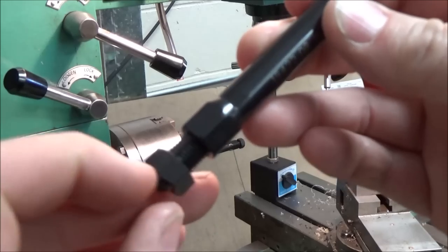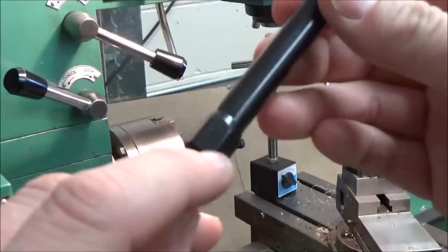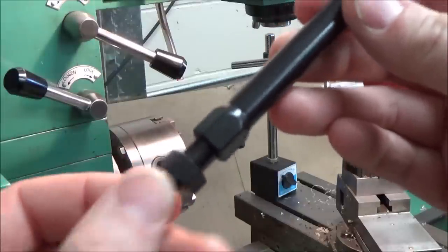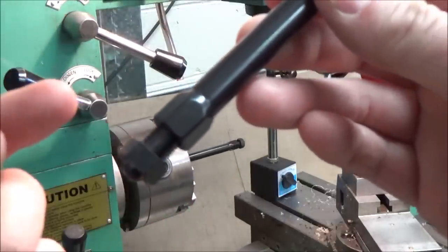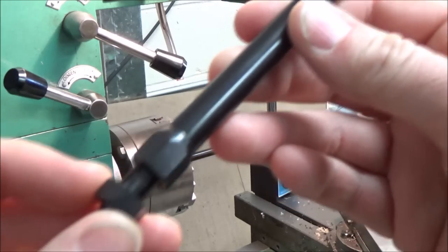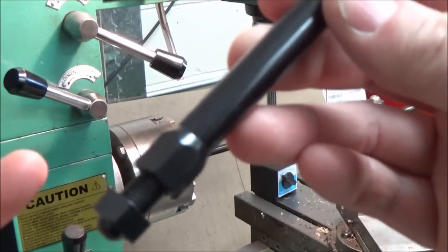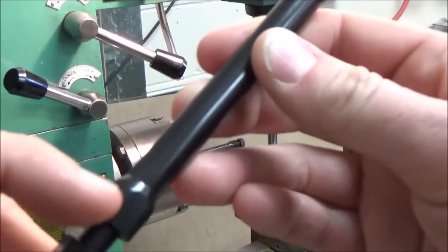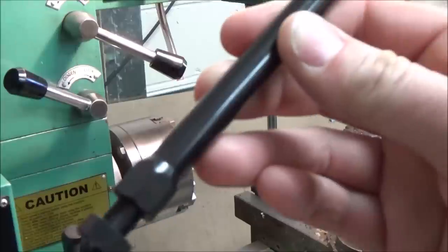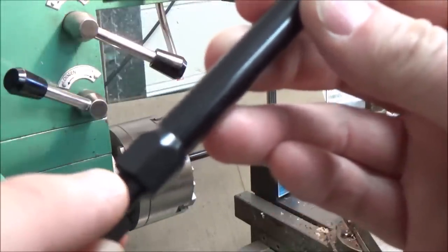Each one of these is a flat, so if it says 14 flats, that's every time you turn this — and it can be kind of a pain, you'll see when we go to put them on the bike. You have to be very intentional about watching what you have going on. I like to count turns — like three turns or three and a half turns — and then I'll do a paint mark on here. That'll help me make sure that I've made one full revolution versus just counting flats.